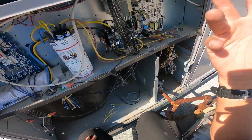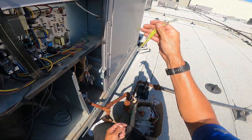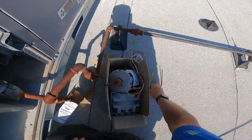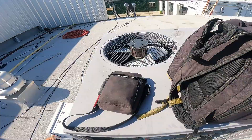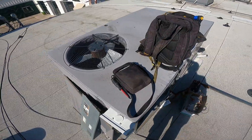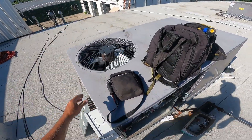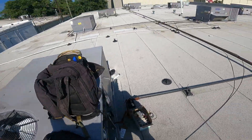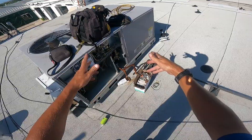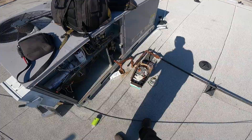I don't see it coming on, I really don't. But I always save these jumpers - they come in handy. We're not even gonna bolt her down yet, let's see what we got. Oh, almost fell on the capacitor. And we got a fan! I don't know how that's working. Simple, easy, quick - I ain't got to do the thing with the motors. I dragged two motors up here, wasted all that time, and all it was is a dadgum capacitor.